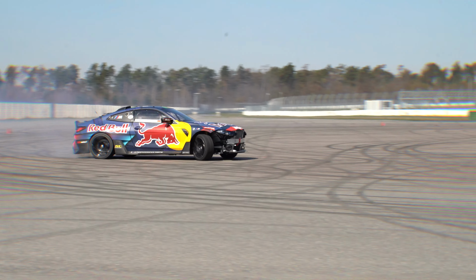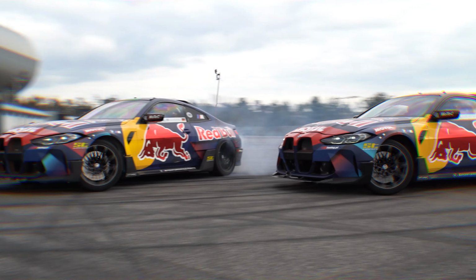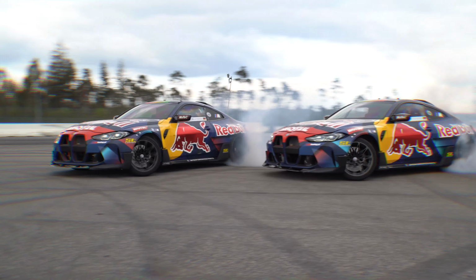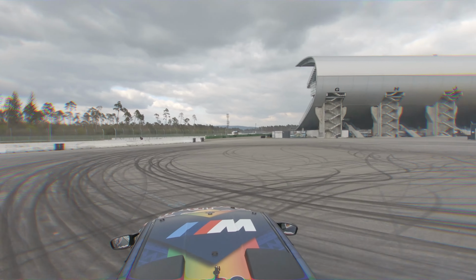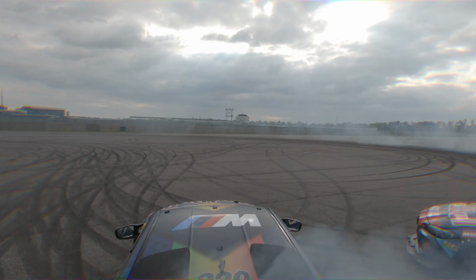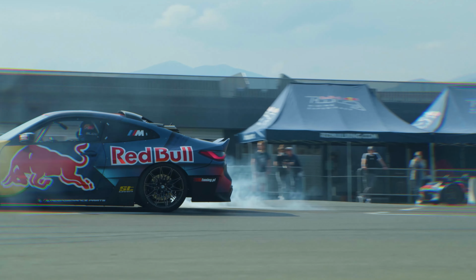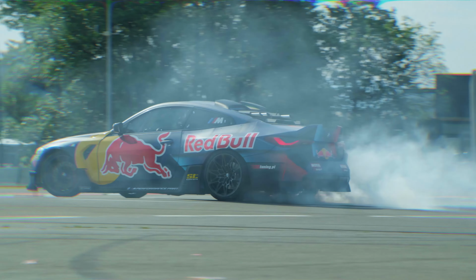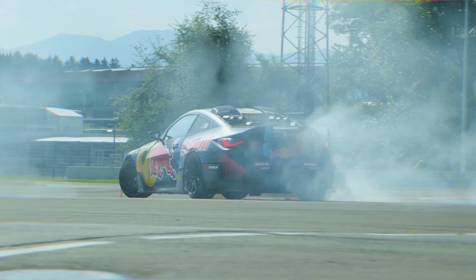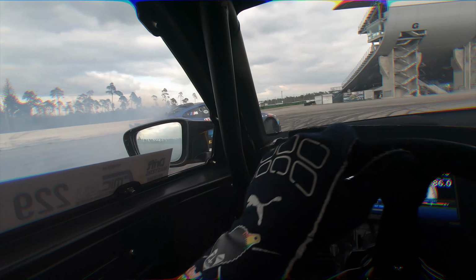Another vital reason why in drifting you have more front brake bias is that if you're in tandem drifting, you want to slow the car down. You often use the foot brake as it's the smoother way to adjust the speed. You can also use the e-brake. However, you always have to remember the tires are spinning at whatever speed they're spinning at the moment. Once you pull the e-brake, they are down to zero. Next thing, you release the e-brake, you leave the clutch in, and the tires have to go up with their wheel speed to the speed that they had before. So this is quite a lot of things happening and a lot of upsetting the car. Also unloading the suspension in the rear.